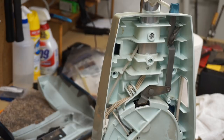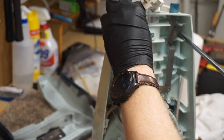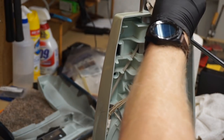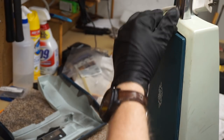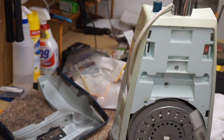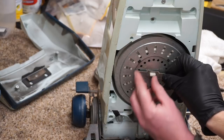Okay, so as we're getting this thing apart, we've got this cover off, we vacuumed and blew this out with compressed air. But there are tabs in the front, and you want to just kind of work your way top down. And if I grab another screwdriver, this might be easier. Ah, there we go. And we got one more here, and it's going to rock off from the bottom. Then you can see this is starting to pull off. And that pulls off, and you can see, obviously not a sealed system. Made way before that whole idea. And now we have the cord winder, and there's a special tool that I didn't know existed till today, and some good help from Reggie, he suggested we use this tool on here.